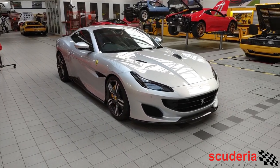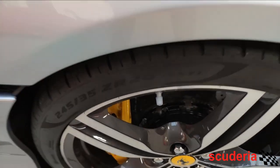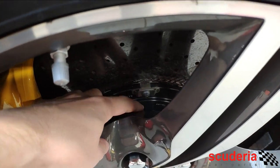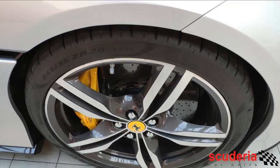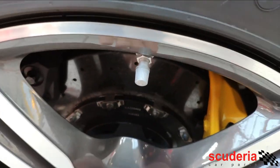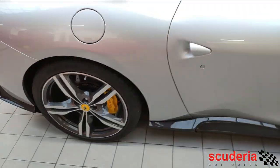That's not the only thing that we've done. We have also installed spacers. If we have a look in here, this element right there just between the brake hub and the actual wheel itself — we've spaced by about 10mm in the front. If we come to the rear, these ones are 15mm. And those are hub-centric spacers.